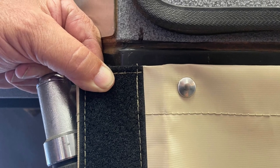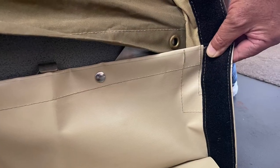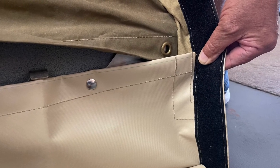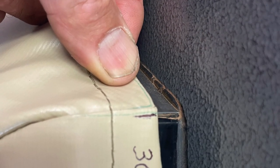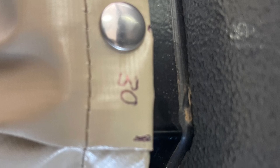Velcro has got to come in 20 millimeters from the edge of the stainless steel to get the first press stud. The second press stud requires you to line up the Velcro at the floor end. The third and fourth press studs come in either end of the wheel arch.